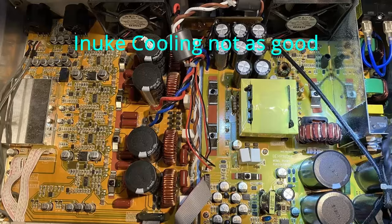Why would someone want to buy the Behringer? I think the only reason is its rated output — which, of course, isn't even accurate. But even with the misleading specs, it still is the most powerful of the three units, although you could get a more powerful Crown XTI at a similar price point. The Behringer offers the cheapest cost per watt, but the truth is it's just not necessarily a great amplifier compared to the other two. You'll have to replace the fans, and I know quite a few people whose Behringers haven't lasted.